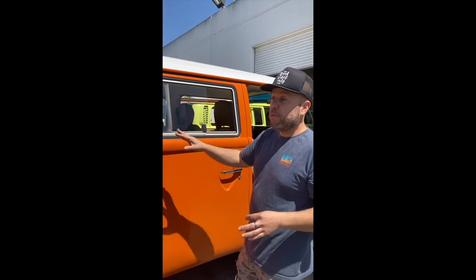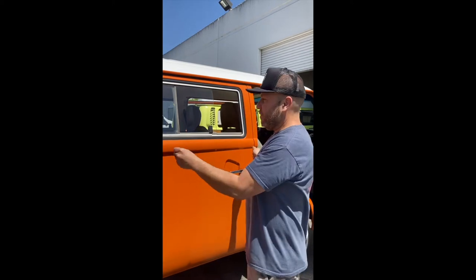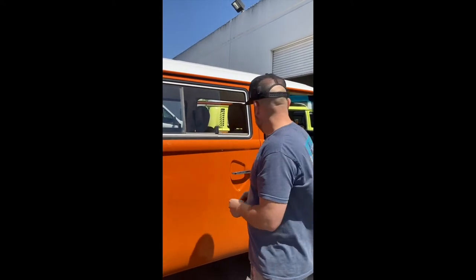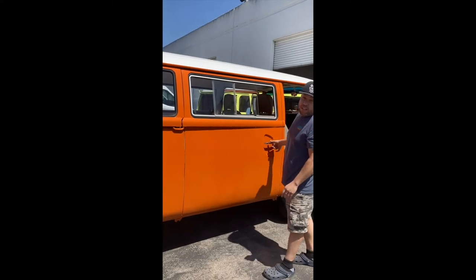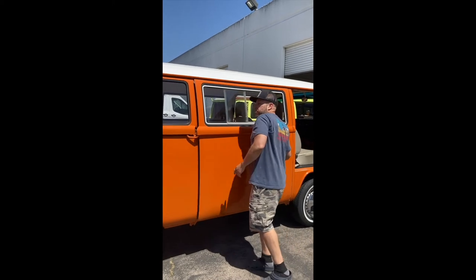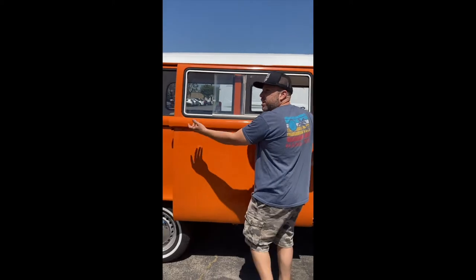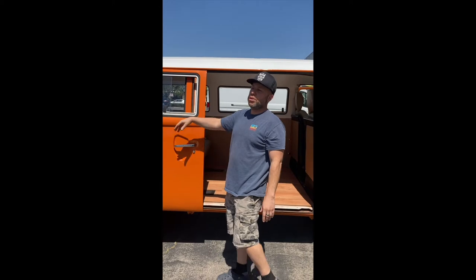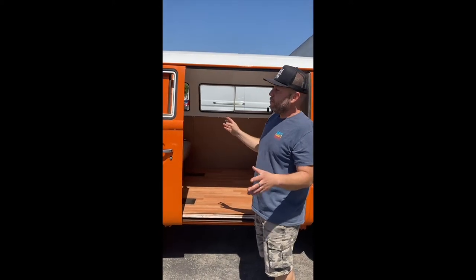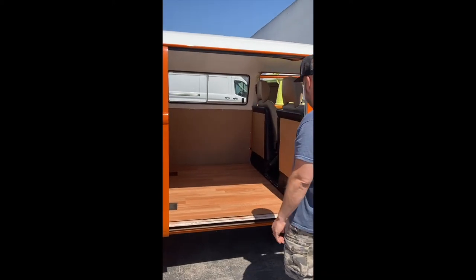For VW buses it's always a little trick opening up the sliding doors — some open up really nice and some need WD-40 and a little wiggling. What I've gotten used to doing is a little guiding right here and pushing down at the same time. When you click it, this one comes out on its own, but some don't — you have to wiggle them or add more lubrication. The last final step would be replacing that back latch mechanism.